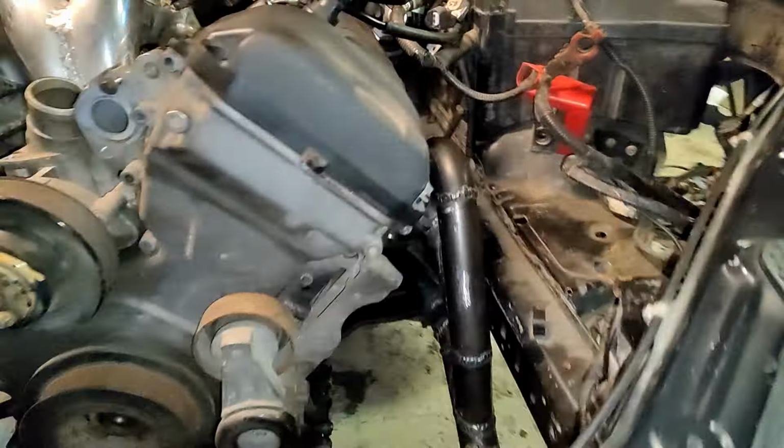And regarding the dump valve, I don't have it yet, but I have a place for it here. And as you see, there's a connector there that won't be used, I will use a banjo line to run a return line on the fuel line. So don't worry about that space claim issue. It's not gonna be a problem.